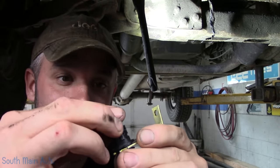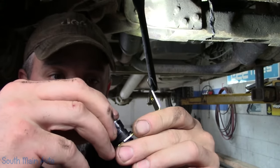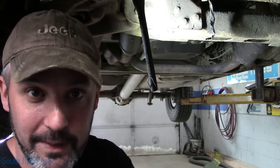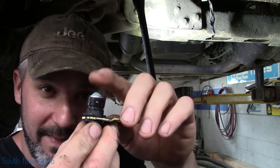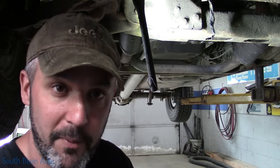Make sure the sensor's dry, not oily. Take the O-ring off so you can insert it easily, and put a little pile of clay on it right there. The important thing is make sure it doesn't go in the timing cover on an open gap on the reluctor wheel — you have to make sure a flat spot of the reluctor wheel is up. We're going to stick it in. I put a little dab of oil on the end so it doesn't stick to the reluctor wheel. We stick it in, we'll pull it out and measure.